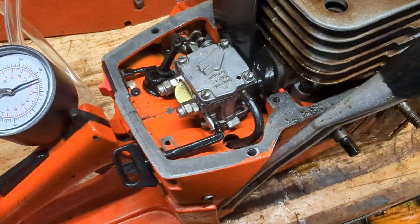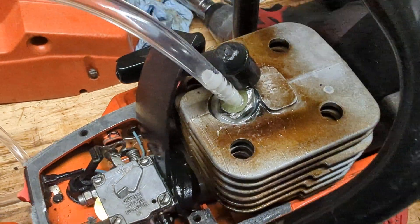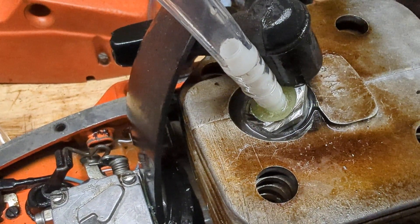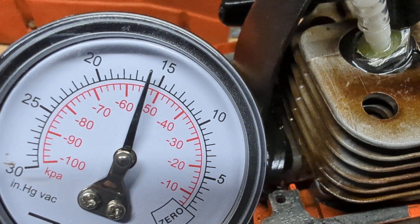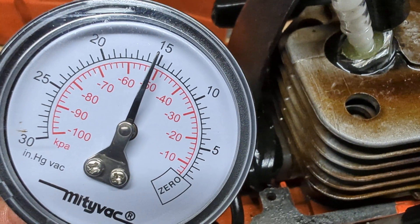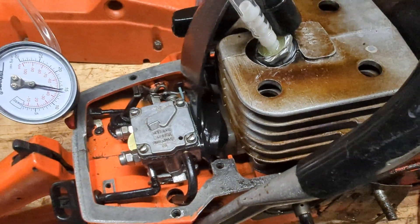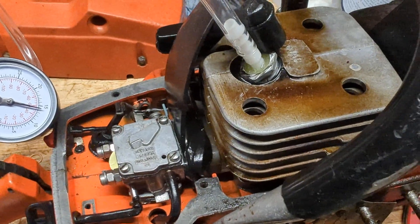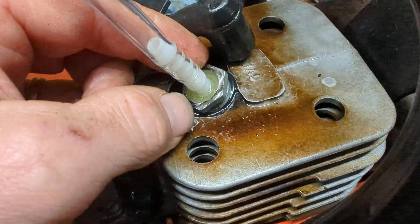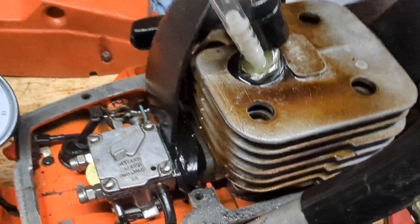It's falling just ever so slowly. The saw starts really nicely. I've sprayed some WD-40 around there and I think it might be falling more slowly — maybe not, I'm not sure, you tell me. Should the spark plug just be finger tight? I did tighten it with a plug spanner but that really deforms the o-ring.